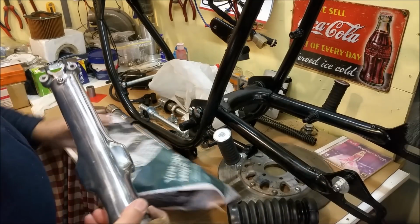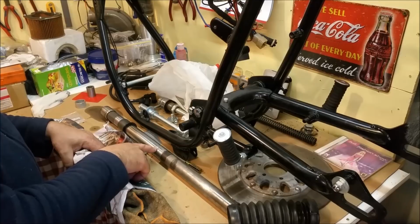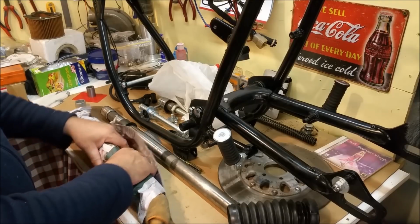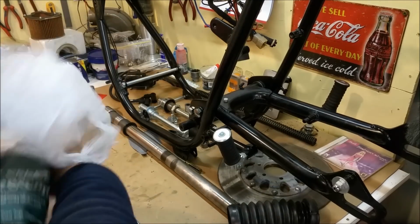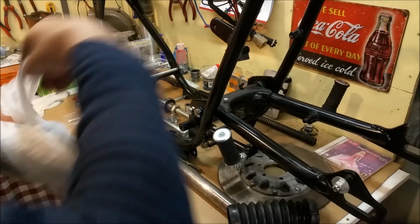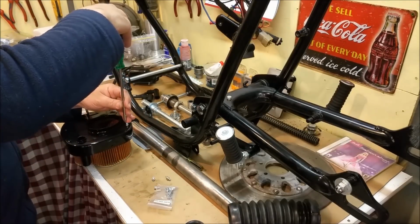They look pretty good. I've just got to check the stanchion doesn't look too good here, and it's been sort of buggered up there, but that's not the sealing area. Someone's grabbed it with multi-grips or something like that to twist it out of the top, out of the triple tree. So we'll just monitor that. If I need new stanchions, I need them, but I really don't want to spend money on those if I can avoid it, because they're very expensive and also very expensive to get sent out because they're very heavy. So the next video on this is basically putting things together.